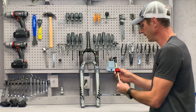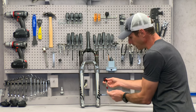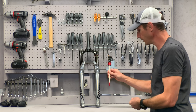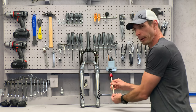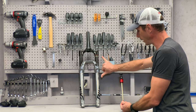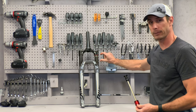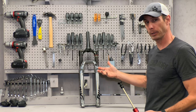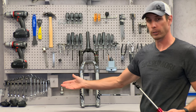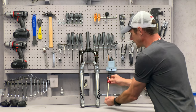What they did is move the dimple up. The bolt on the bottom threads into the foot nut, securing the piston shaft to the bottom of the fork. As you hit a bump, the lowers go up the stanchions — so as this unit moves up, it's pushing the piston up, squishing your positive air chamber. Compressing that air is what provides the spring, and the more you compress it, the harder it gets to compress further, which is why the spring curve ramps up as travel increases.